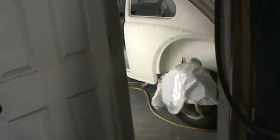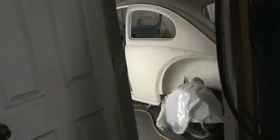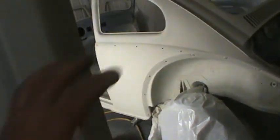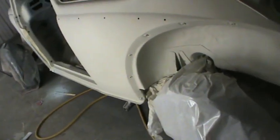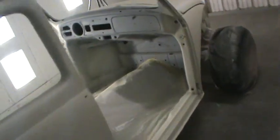There's a little spot on the quarter panel right there — somebody welded that up before. I don't know what's in there, so I'm gonna have to put the fender on, find the hole, and drill and tap it out, maybe put an insert in there. I noticed the other night we didn't really do anything to the back of the car. If I leave that like that I'll get grief — it looks like it had a sheet metal screw holding the fender on at the bottom. Same with this side — for some reason it's missing a bolt hole and it's got a stud sticking out of the bottom.